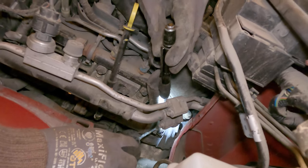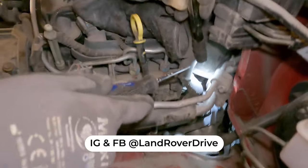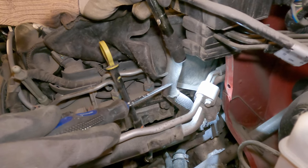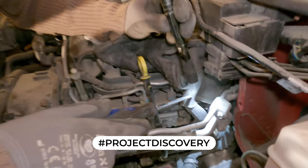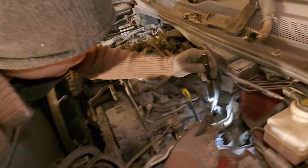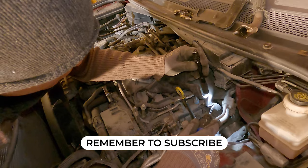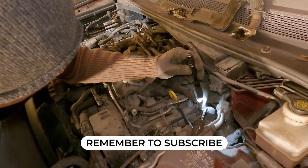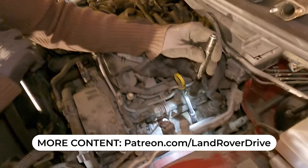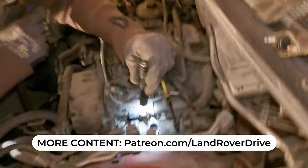I know somebody is taking the coolant hoses and taking the cooler and the EGR valve out as one complete assembly. I normally don't do that. What do you normally do? I normally leave the cooler. Okay, don't remove the cooler. I just loosen it, and we let the cooler stay. And we take the valve, if everything goes to plan.